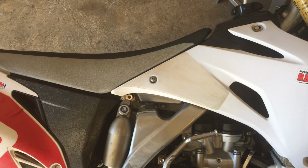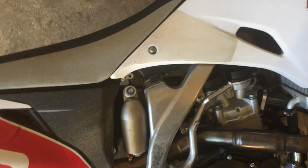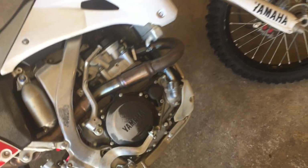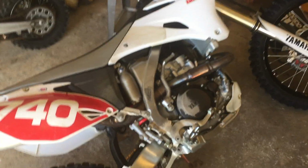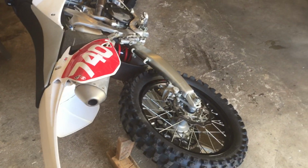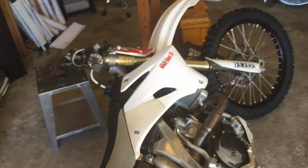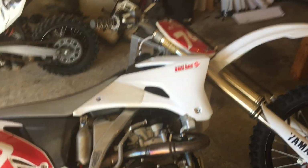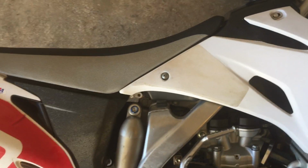And then I just left it overnight with that little tiny hole full of penetrating oil. And that's why I put my bike on its side like this, so that gravity would help pull the penetrating oil down into the threads. But probably would have been better off taking the tank off, but I'm lazy, so I just blocked up the rear wheel and the frame so that all of that pressure wasn't on my steering lock for 24 hours.